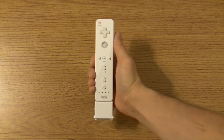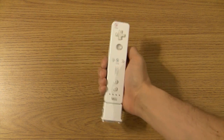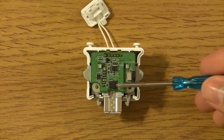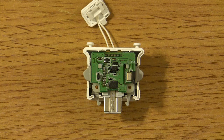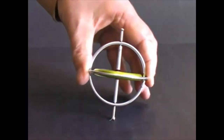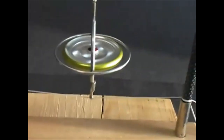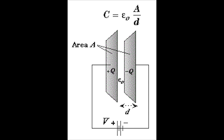Gyroscopes are used to record angular movements. These components are known as pitch, yaw, and roll. In the case of the Wii Motion Plus, it uses a tuning fork gyroscope — actually two: a dual-axis gyro and a z-axis gyro, wherein two test masses vibrate and keep their orientation due to conservation of angular momentum. This means the gyroscope tends to keep vibrating in its initial plane of orientation regardless of where its support structure moves — the same principle at work for larger spinning gyroscopes. By measuring capacitance, a signal that quantifies the rate of rotation is produced and sent to the Wii. By combining the linear readings from the accelerometer and the angular readings from the gyroscopes, the Wii could now record most any degree of motion.